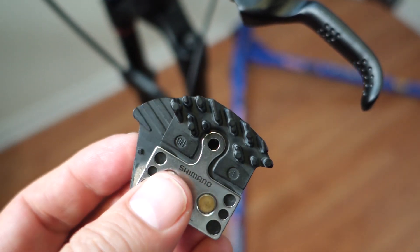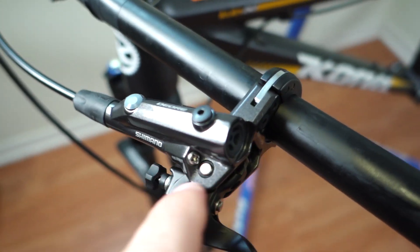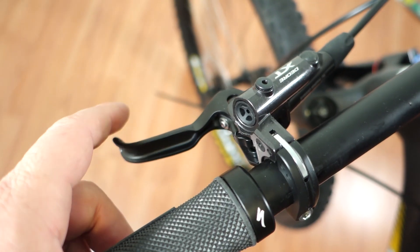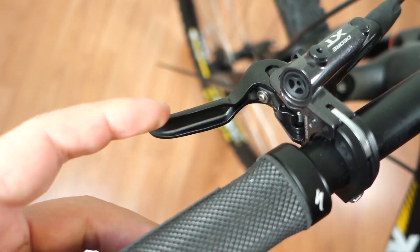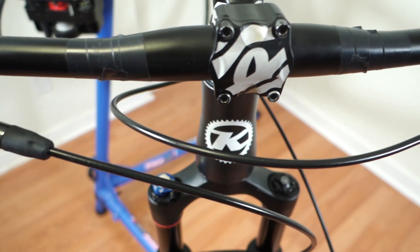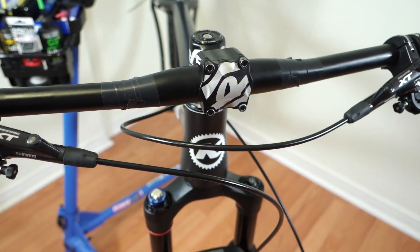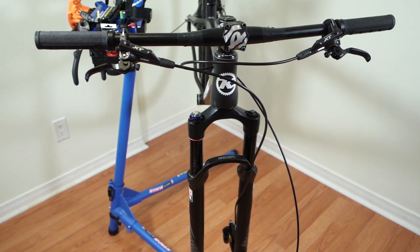Repeat the same procedure for your rear brake and make sure you do a proper break-in of your brake system, especially if it's a brand new one. A brake system with no air in it will give you that solid feel at the lever that would never allow it to go all the way down to the handlebar. A full system bleed requires a couple more steps, but 99% of the time if you're just shortening hoses, this is all you need. If you have questions, let me know in the comments below, and don't forget to subscribe and like this video.